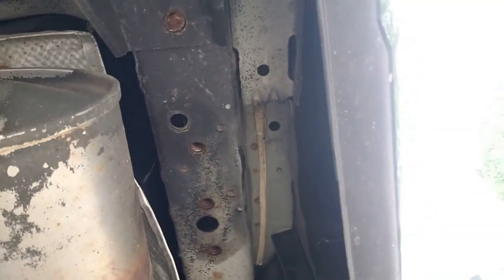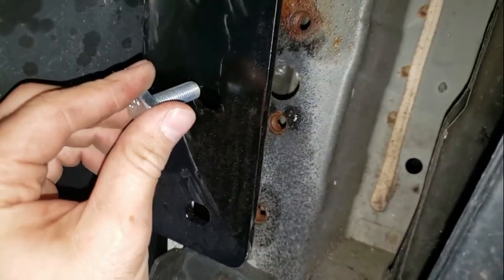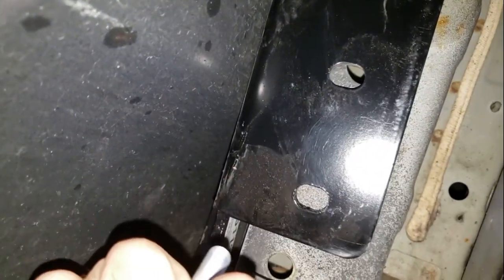I successfully retapped every hole for the bolts, and now it's time for a second try putting this hitch on. The setup bolts are ready to go. Now I'm going to drop the muffler — take it off the hangers — just so I can get up in there to get the hitch in place. Once you have it in place, you drop the muffler and the heat guard. Now I'm going to put one bolt in each section, then worry about getting the washers in, just to make sure all the holes align.